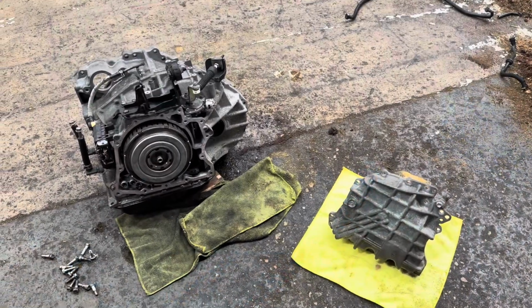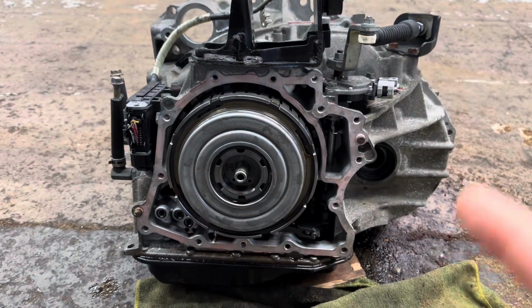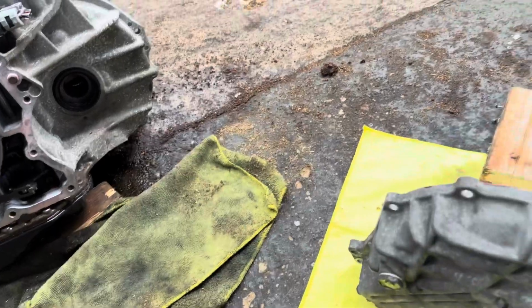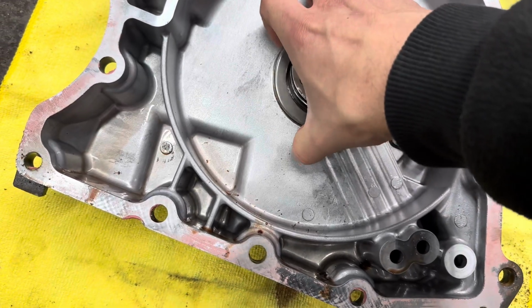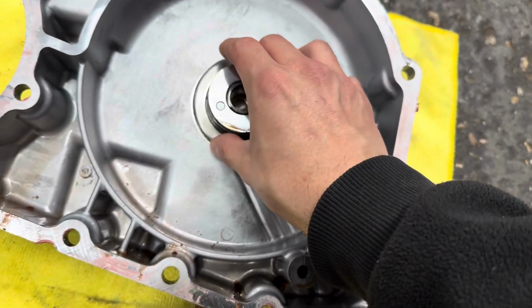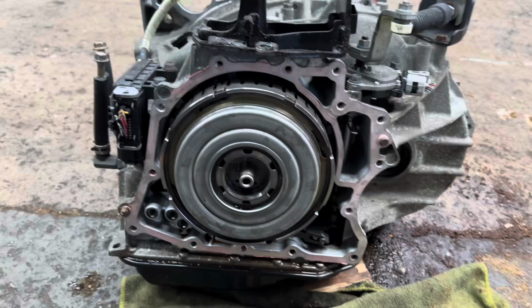All right, moving forward. So basically, first things first, you take off the covers, about 15 bolts all around. Here we have it off already. Once you take it off, there's these seals that go here in the middle. These sometimes fall off easily. We put grease on it to make it stick good. So this one, you're gonna make sure it's secure on the other cover that you're gonna put on here, which is the original from your vehicle.